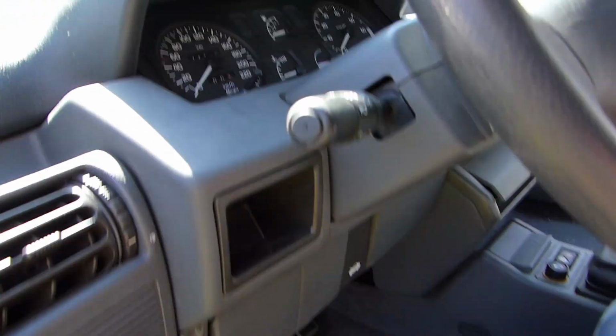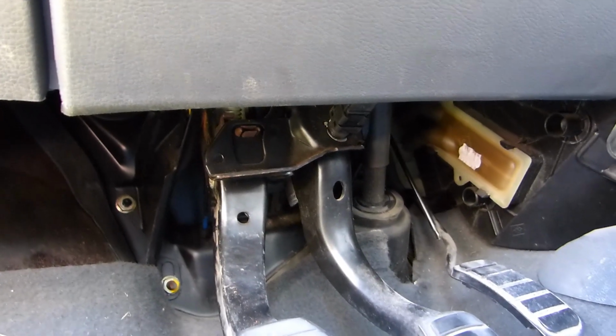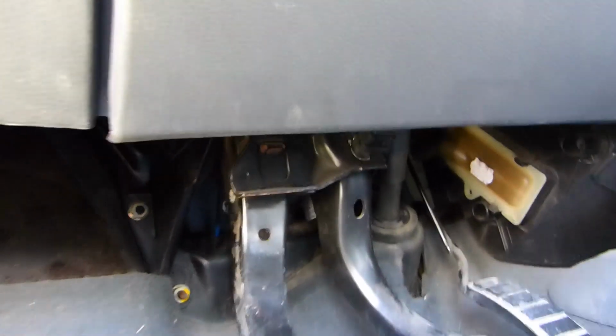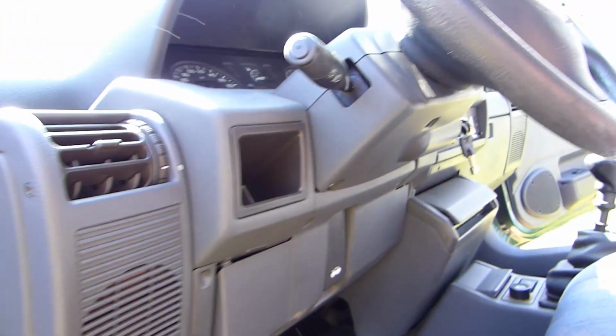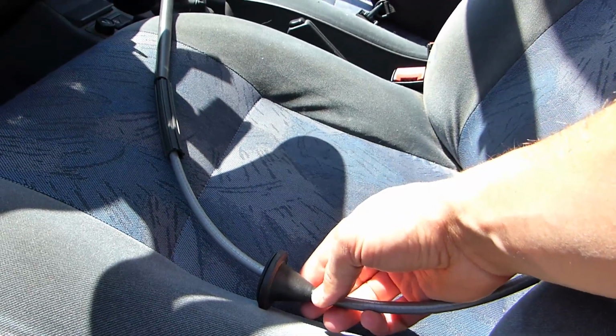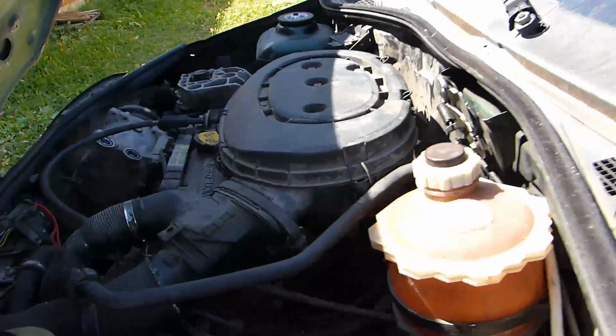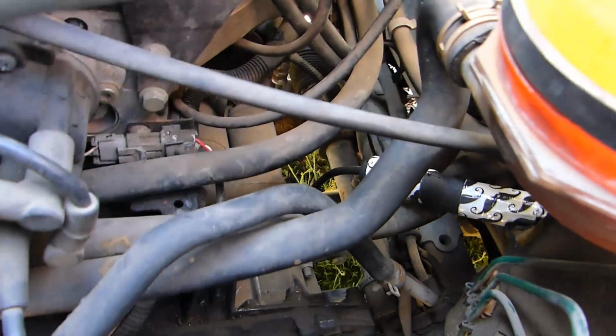progress. So to change it, we have to bring the cable through the engine bay into the car. It comes through just behind the gas pedal, and I think the easiest way was to, when you can see this part, to pull it inside the car, and that's what we're going to do. But first I'm going to unplug it from the gearbox.